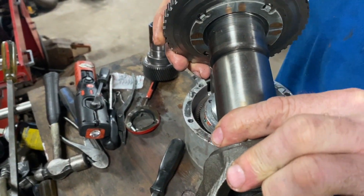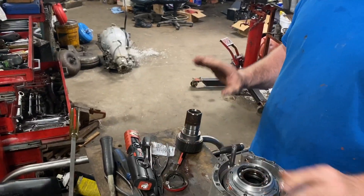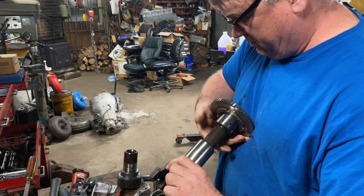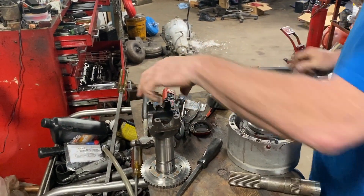There's no play in it. The reason we can't reuse this is because it has too much play and it'll slap when the motor runs. Now I'm going to put the input shaft and the output spline both on screen side by side — you guys count the teeth on both units and see what you come up with.